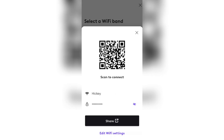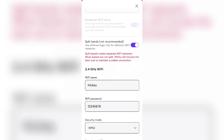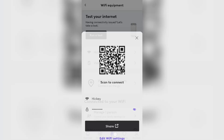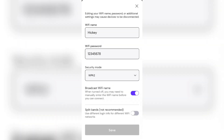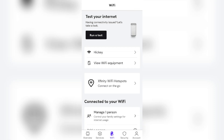Now when you click on view Wi-Fi bands once more, it's going to show you the two different split Wi-Fis, and you're going to be able to connect your device to your 2.4 gigahertz Wi-Fi. If you want to unsplit it, simply hit unsplit and hit save. Now it's back to just one Wi-Fi name and one Wi-Fi password, and you're back to the way you started. Don't forget to keep that Wi-Fi name the exact same, otherwise you'll have trouble.